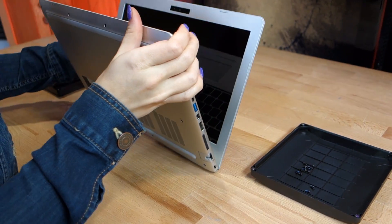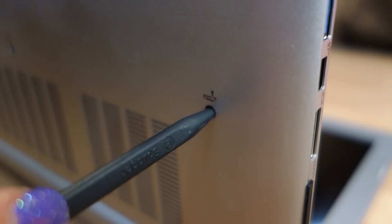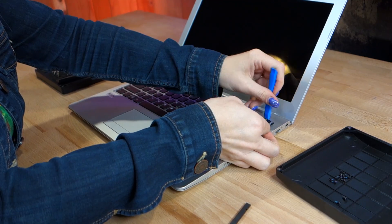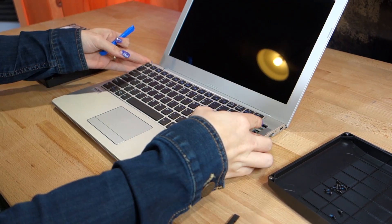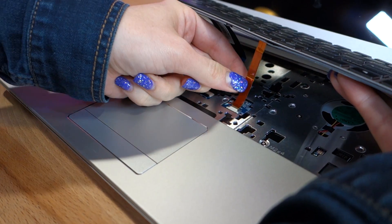Now open up the lid to pop out the keyboard — make sure to do it carefully. I found the iFixit spudger fit perfectly for this. This video is not sponsored; I'm just a really big fan of both System76 and iFixit. When you are popping out the keyboard, do it slowly so you don't pull on the two connector cables which are right underneath it. Unplug those two cables very slowly so you don't end up damaging them.